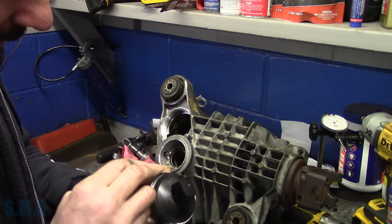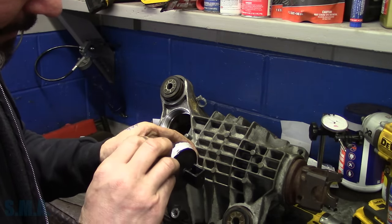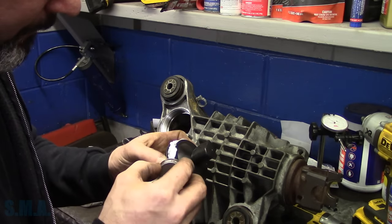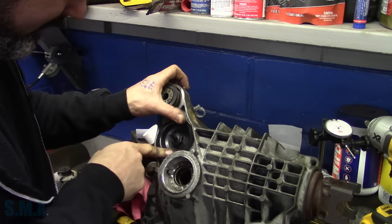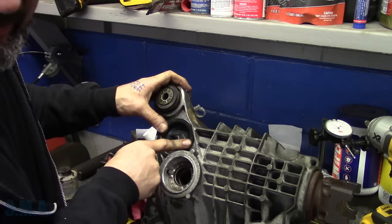We're probably going to have to wipe this around with our fingers, and then put them in. This seals them up pretty good, despite the fact that it has an O-ring also. Usually something like this works pretty well. It keeps these things from peeing all over the place and giving you the false sensation that you have a leaky axle seal. And the biggest thing when you're putting these things in, make darn sure that you start them by hand. These plastic threads, you can strip them real easy, or cross-thread them, I should say.